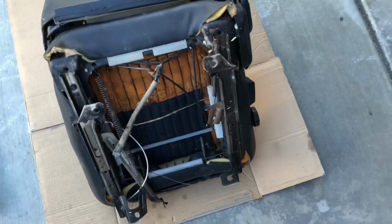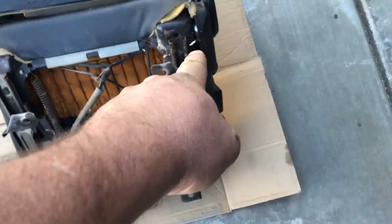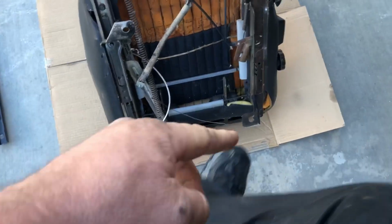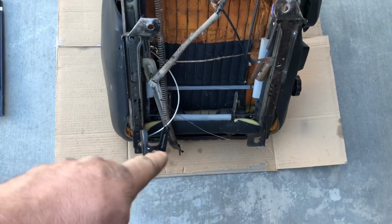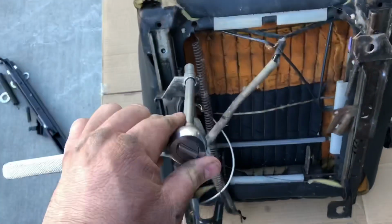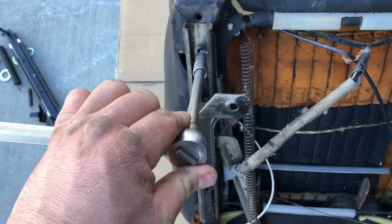Like I said, I can't do it off camera. Slide the other rail down all the way. That'll give you access to the 10 millimeter bolts. Then as soon as you do, slide both rails up. That'll give you access to the two bottom ones. Remove the top two bolts. Like I said, it's very simple. You know, just a ratchet.